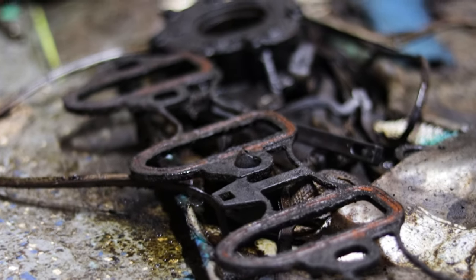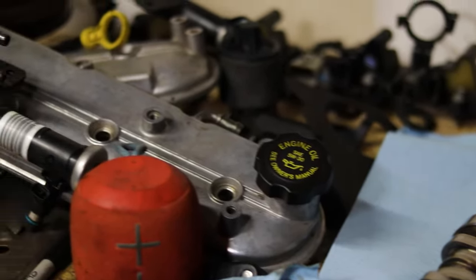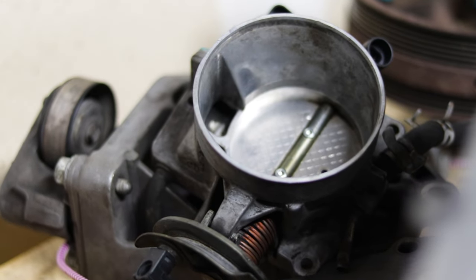We did it again — another late night in the garage cleaning car parts. It took way longer than I originally planned, but I literally cleaned almost every single part that goes inside of this engine. This thing had 360,000 miles and was the most sludge-contaminated, carbon-filled mess — very, very difficult to get clean. But I was able to do it with just Dawn dish soap and water. I used a little bit of brake clean just after everything was done to make sure there was no soap left, but it was primarily Dawn doing all the work. And my elbow grease — I literally rubbed a hole in my sweatshirt. It's been a long night. I'm going to go get some food. Hope you all have a great one and I'll see you in the next one.